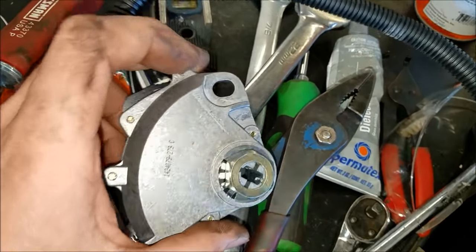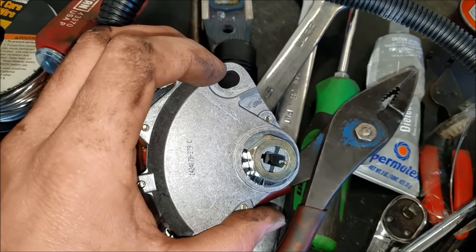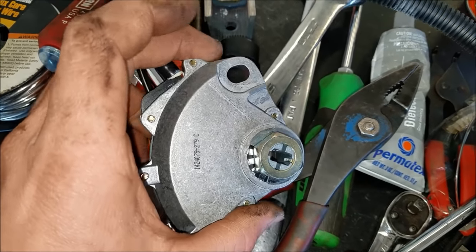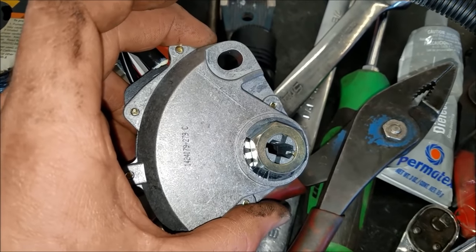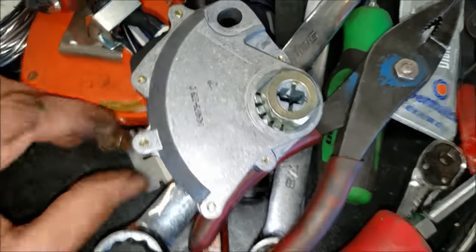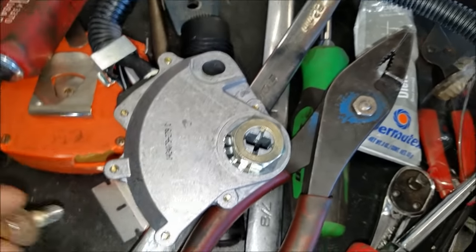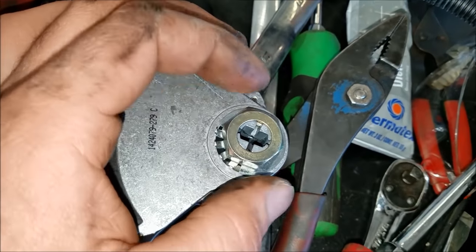To remove this thing, you're going to remove the 12 millimeter — might be a 13 millimeter too, I've seen on them. Up top here you'll notice this hole is elongated, so that's going to be your adjustment when you're putting this back together. You're going to have to put this thing in park and then you might have to wiggle it one way or another and then lock that bolt in place. That bolt — you can see it's got some play side to side in there. Then loosen this with an adjustable wrench or a 22 millimeter, 7/8ths.